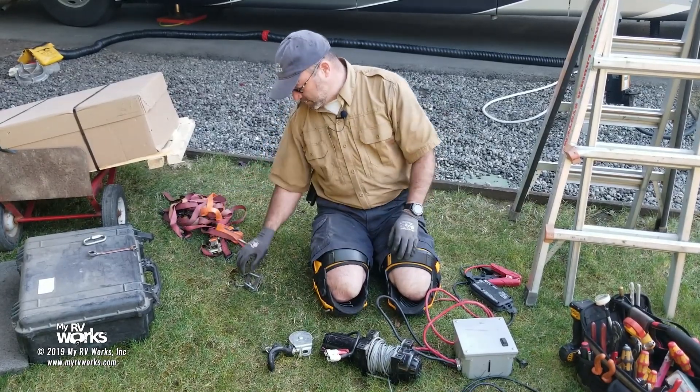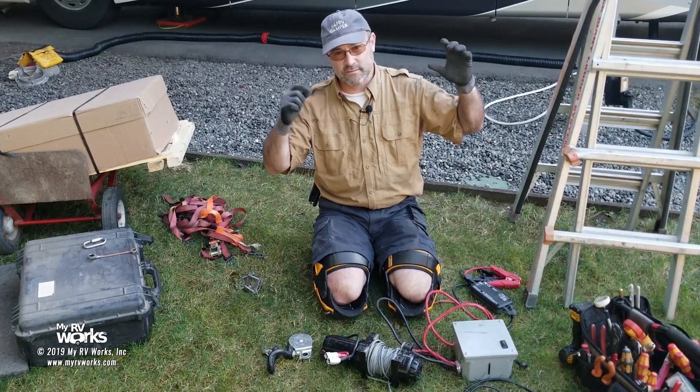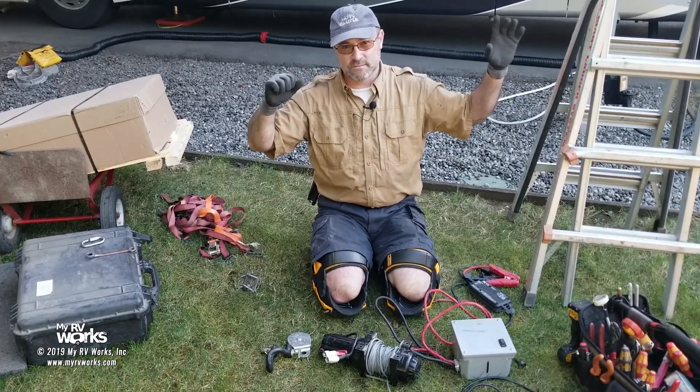I use a battery pack on these leads to give power to everything, and this is usually enough. I'm going to open the ladder to make it really tall, use a twisted clevis, feed the line through the whole thing, and you've just created a crane. Then we're going to use straps to tie this ladder down really well because we don't want it moving when we're elevated and pulling the air conditioner up above the roof line.